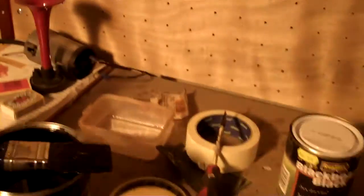Right, brushes. Just want to show you a little trick now. First of all, obviously, when you're finished with your brush, just get the worst of what's on it and brush it out on something, just to unload the brush. Obviously I couldn't scrape like that against the bodywork because it will drag all the cotton, so just a little bit of chipboard here, and once you've got as much out as you can, it's got to go in the thinners.